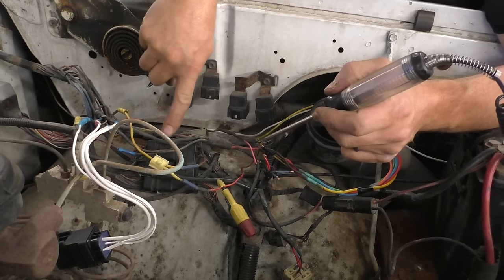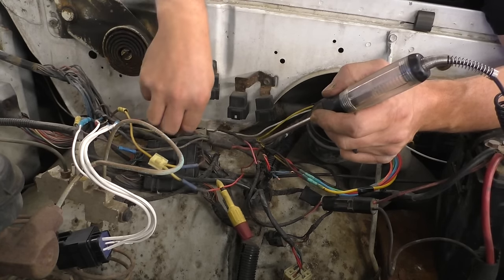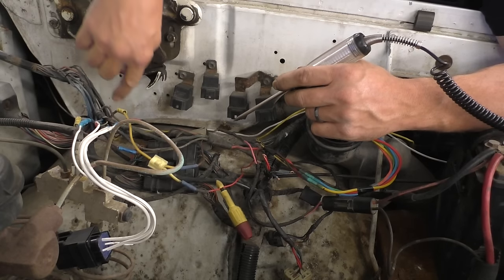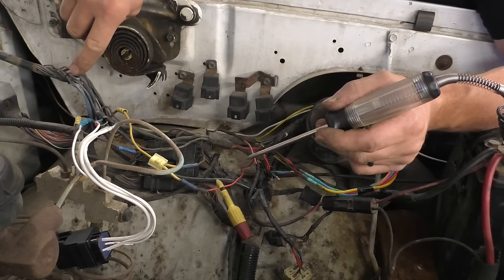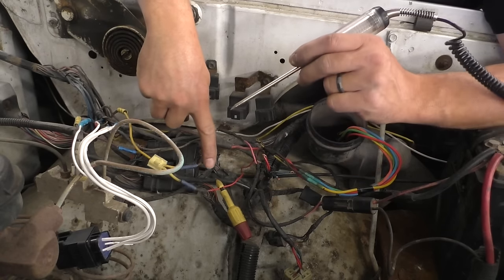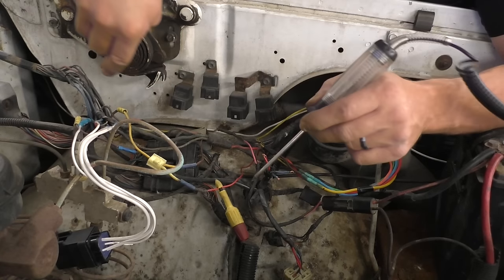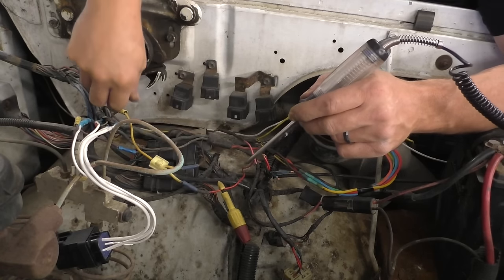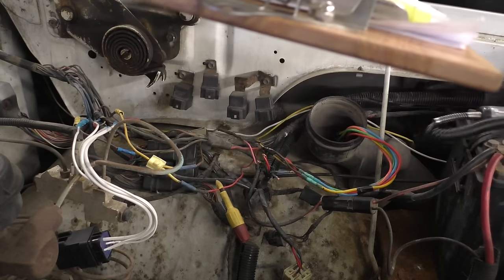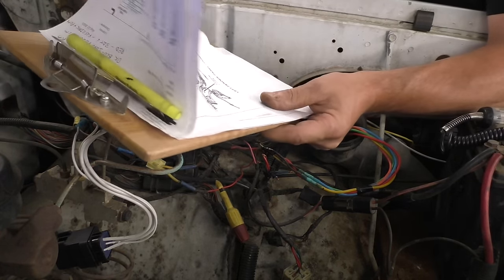We talked about these fusible links. This is an orange fusible link. This is the other one. This one comes out and goes down to a very corroded, puffy wire, which we determined still carries current, but it's not the right color. But then we run into this little rigmarole. And from orange, it was supposed to turn into a white fusible link and then split off to two wires, a red wire and then another red wire, I believe. One went to the ignition switch and the other went to our relays, auto shutdown.